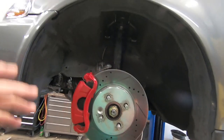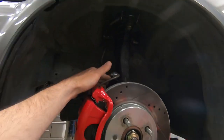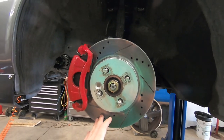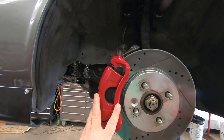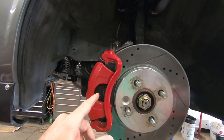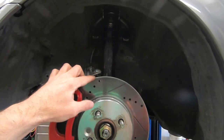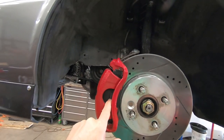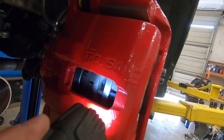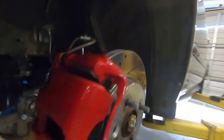If you want to take it even further, you can also upgrade the brake master cylinder and your brake lines as well, which I did. The 07 Mini Cooper base model 280 millimeter rotors and ITR brake calipers and brackets are what you need. You can run the ITR pads but they will overlap the top of the rotor, so I went ahead and sourced 04 to 08 TSX pads. The TSX pads sit just a little bit below the lip, which is just about perfect, and this will give you pretty much a true Type R brake setup on your Civic.